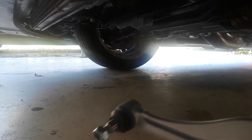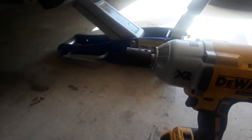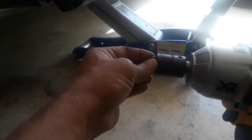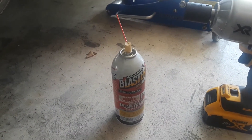The first thing you want to do is loosen this nut which is located right in here under the ball joint. I've already done this — just loosen that — it connects there, it's a 21 millimeter. I used my impact, and before I got started I used PB Blaster and let that sit on there for a couple minutes.